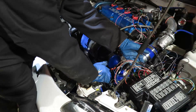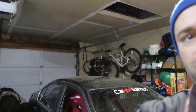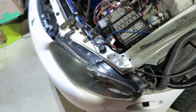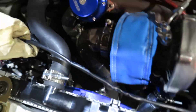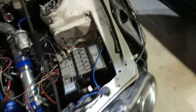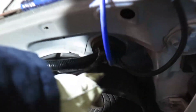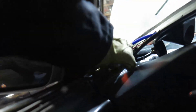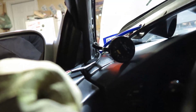I'm going to tie it to the radiator so I don't pull by accident as I'm trying to route this inside. Once this is done and the car starts and everything is good, I'm going to wrap this up, put everything here, and make a little piece of carbon fiber — it's going to be pretty cool. All routed — the old one is going to the trash. This goes all tucked in, this is my xenon lights, it's going to be bolted here, here, here. It's all secured. I have enough to go all the way to the ground, then this goes hidden through the firewall and inside the car. The worst part is putting all those guys up here, but yeah, we made it.